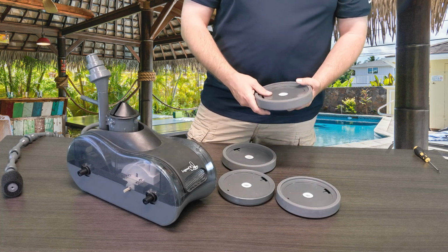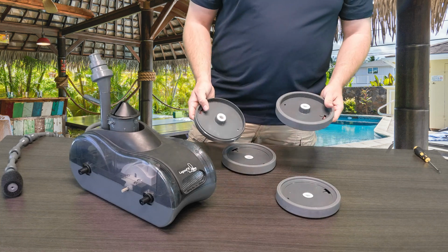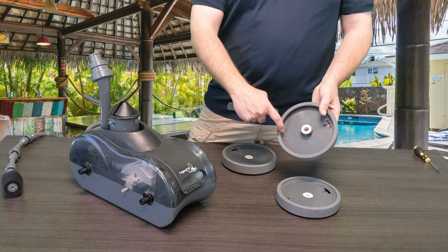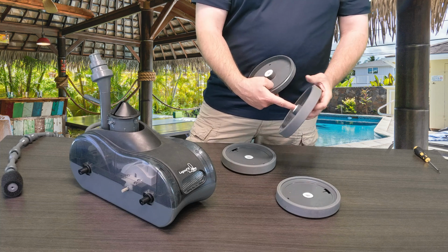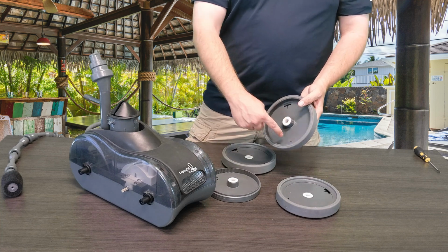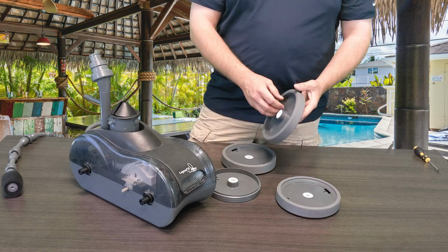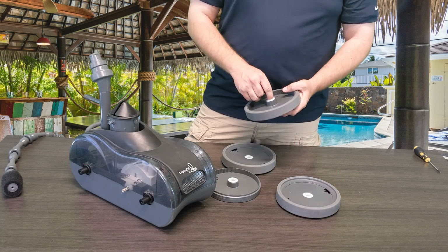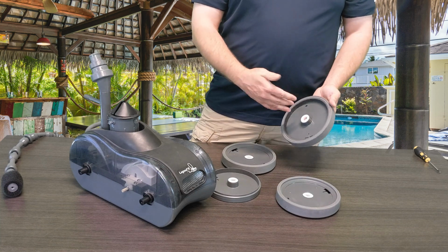With these pressure cleaners, typically they're only a two-wheel drive. So your front tires are going to have, in this case all of them do, just because they didn't make any front or rear types of tires, but the front tires are going to take a wear on the inner part here. So it is important to make sure that these bearings are up to speed, because if for whatever reason things get hung up on these bearings, you're going to have a metal shaft rotating on a plastic wheel, which could just wear this down and incur more costs for you, especially on buying an entire new wheel assembly. But today we're just going to show you how to take out the old bearings if they're still in there and replace them with new bearings.